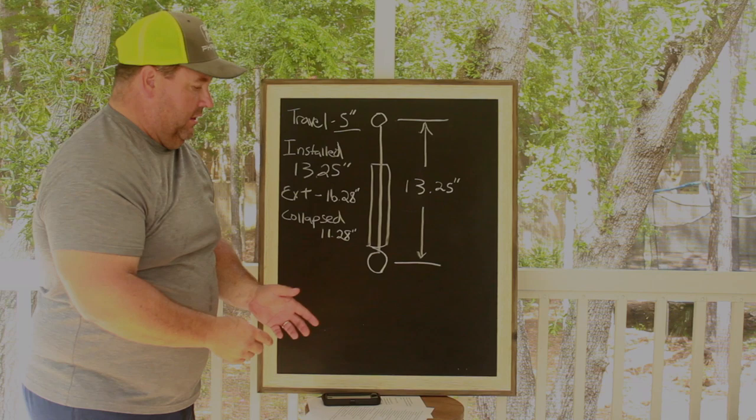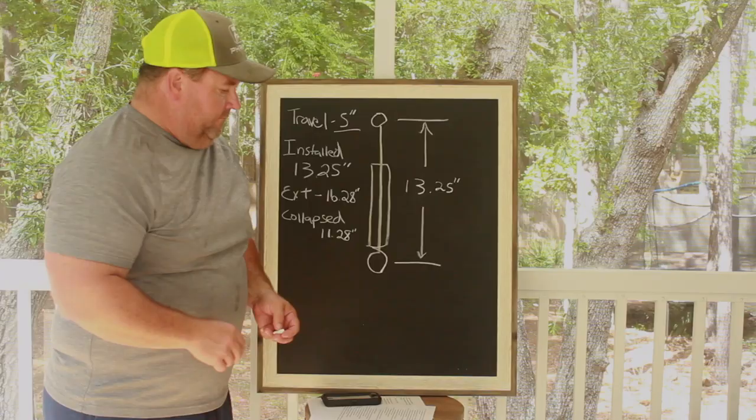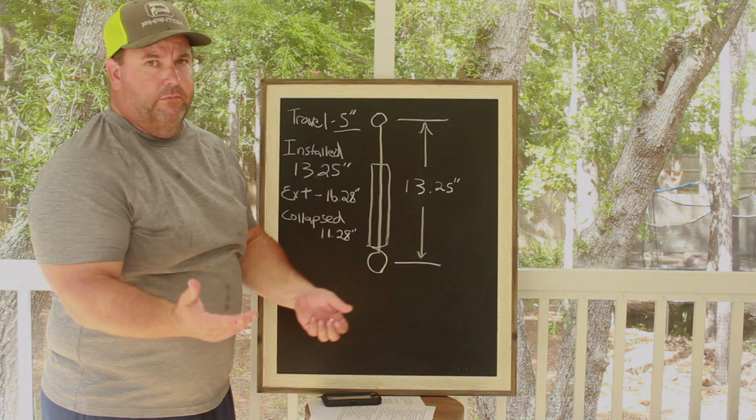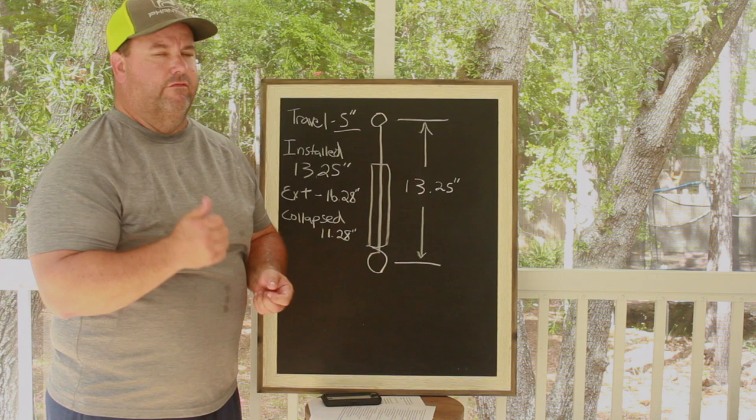So that is number one — what is your part number, who makes it, what is the spring weight, who makes it, so we can verify this information. Now let's go to step number two. Question number two: I'm going to ask you, are you running a four-link or a ladder bar rear end? 90% of the people I work with are running four-link. I do have 10% still running a ladder bar — nothing wrong with a ladder bar car, they work great, but they have a few different things to consider in tuning.